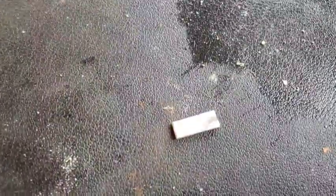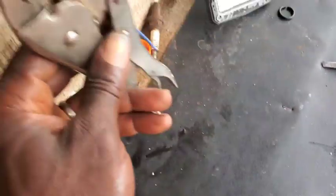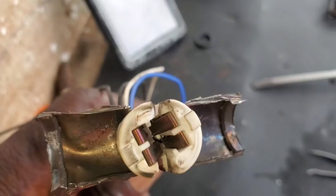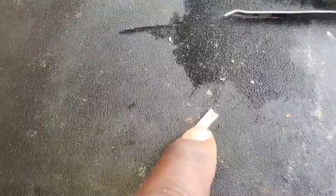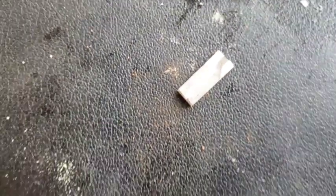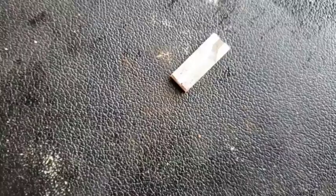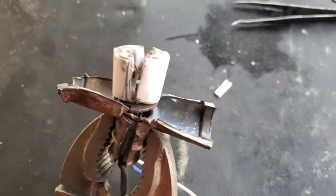So that is how the heating element is — it's holding the heating element inside. This heating element here is what often fails most often in an O2 sensor. So this one has broken. In another episode we'll cut it again. You can see it's made up of ceramic, by my observation.